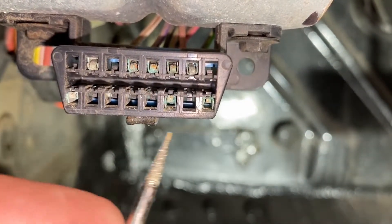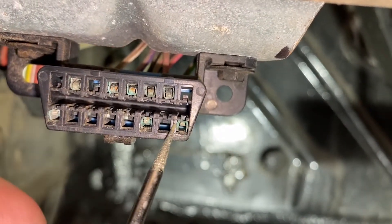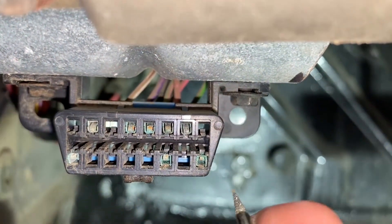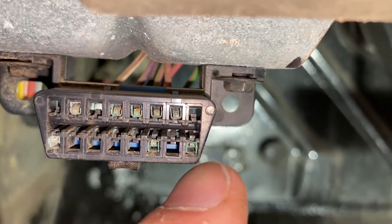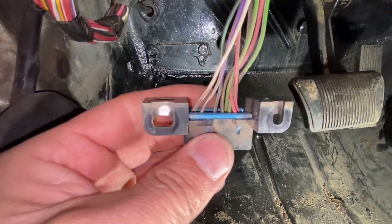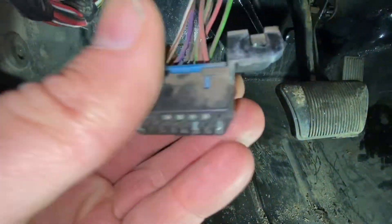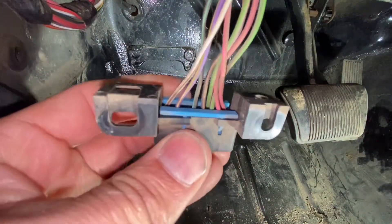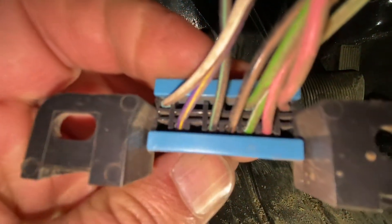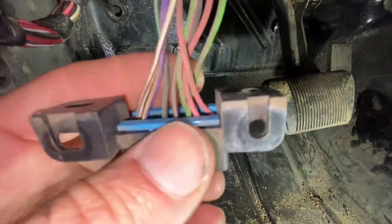It is working though. I'm going to clean all these and then I'm going to unscrew this and pull that one out — you can pull it out. You have to lift that little tab there with a tiny screwdriver and then I'm going to see if I can correct this. One other thing: if you're going to pull any of these out, take a photo of it so you don't accidentally forget what goes where. Every vehicle's different.